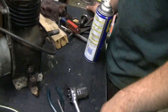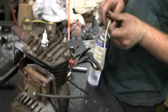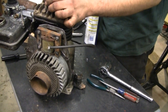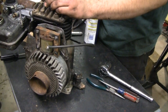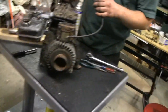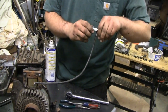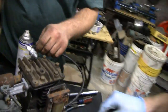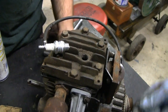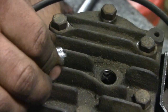It's ready to go Mike - check for spark. Pull that spark plug out. Hold that plug and we'll see if it's got a spark. Let me zoom in. It's kind of light. No good. Try it again. No spark. Maybe it's a bad ground - there's a lot of grease on that engine.